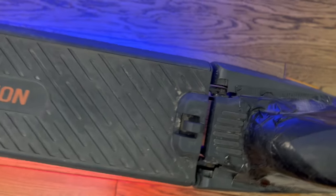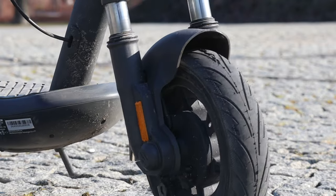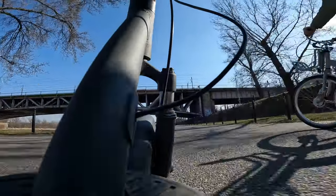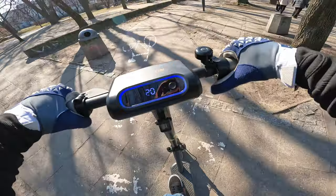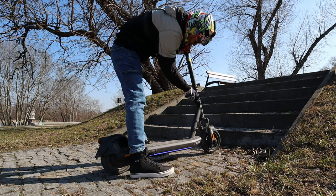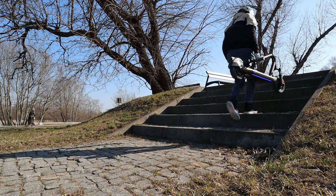It has pretty good 10-inch tubeless tires. Maybe the only real gripe I have here is that it has a front drum brake. Even after 100 kilometers I could really feel that they lose their strong braking ability, and they're quite difficult to exchange. So in the future I would really like to see either a more powerful electronic brake or a disc brake in the front. This drum brake solution — I'm not entirely sold on it. When folded the scooter also feels durable, it locks in place, and with a weight of around 24 kilograms it's just on the edge of being a light commuter scooter.